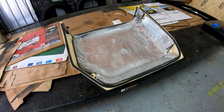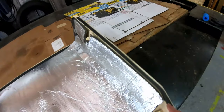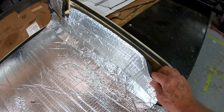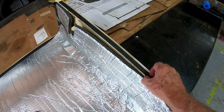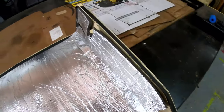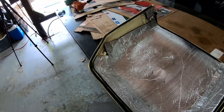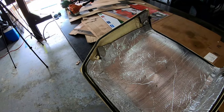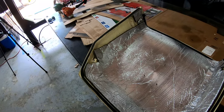Here's the underside of that engine cover. It already has some kind of insulation on it - it's like foam rubber with a little bit of aluminum on it. I think it's more a heat shield than a noise shield. It also has a rubber gasket that isn't long enough so it didn't lay down right. What we're going to do today is get all this off, clean it up, and then we'll be ready later this week when we get the new heat and noise shield materials.